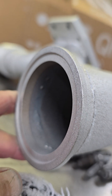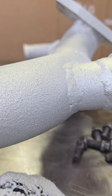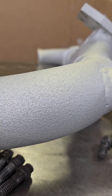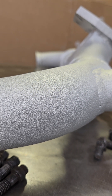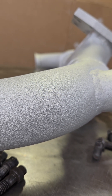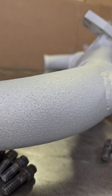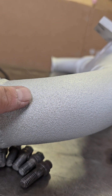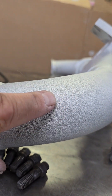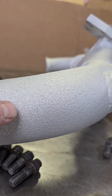The reason for the extremely rough finish is that first they ceramic coat — they spray down the whole assembly with a base coat. It's sprayed on the V-band clamps as well. Most of their ads show a very shiny, smooth silver exhaust which only withstands up to around 1200 degrees. But this 2000 degree coating has a ceramic base coat, and then they spray a wire that is turned into plasma and sprayed onto the exhaust pipes.